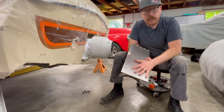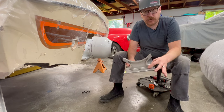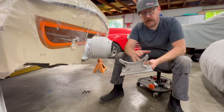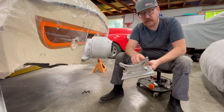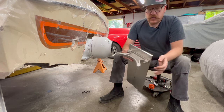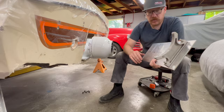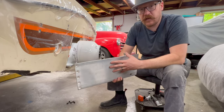Now that I was able to get everything squared up on the bench and got the cradle mounted square, true, and centered to the ride plate, I can go ahead and bolt the ride plate back up to the shoe. When I lift this up to the bowl it's naturally going to center itself, which makes it a lot easier to get these holes positioned, marked, and drilled. Got the holes countersunk — I still left it a little bit loose with a little free play so I can be sure it sits where it wants to. I just need to get this back onto the intake to continue the mock-up and get everything finalized.